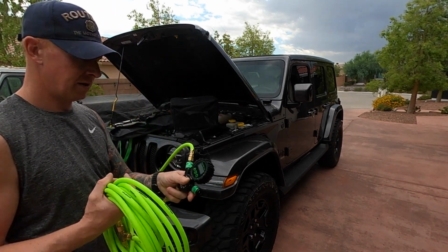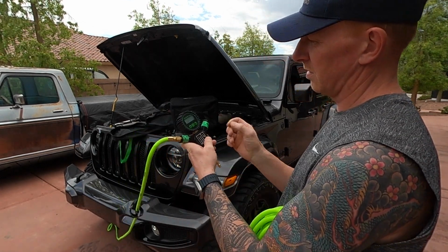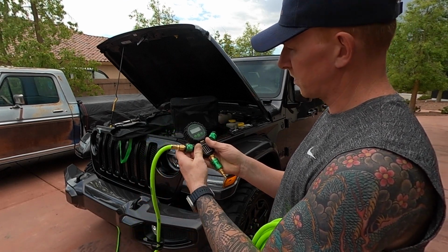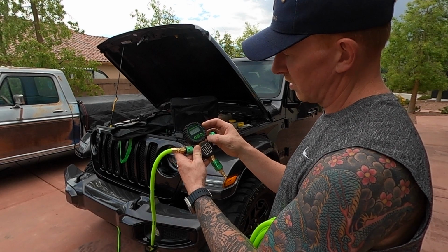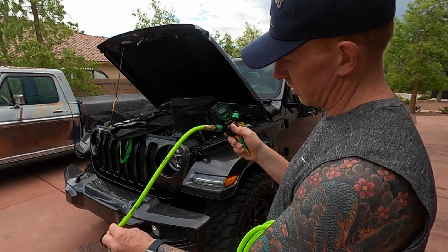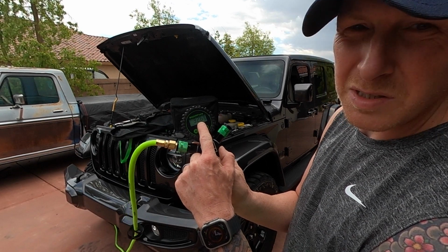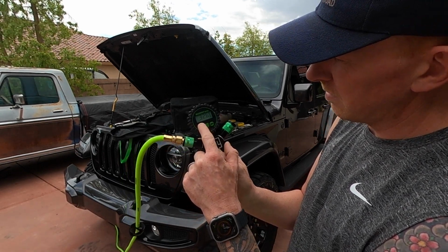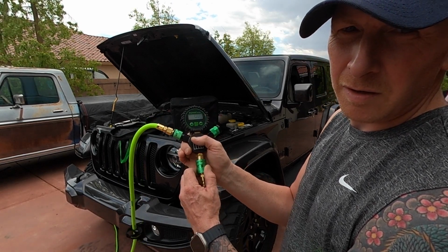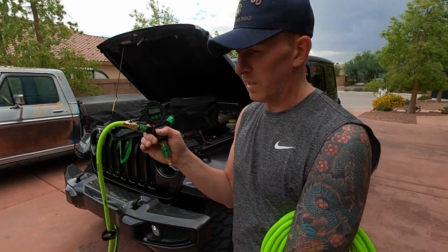And then you have this guy, which, in my case, is already connected to the right side of the car. This one is the one telling you how much air we have in the tires, or actually in this circuit, which includes my 2 right tires. So you see right there, 32.6, and we are on PSI. If we want to deflate, we simply just open up the valve and the pressure will go out. So it's very simple actually.